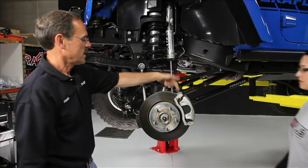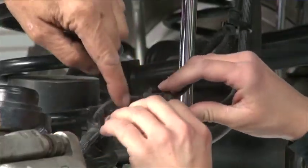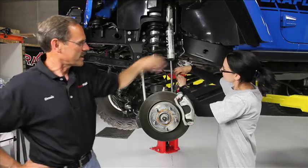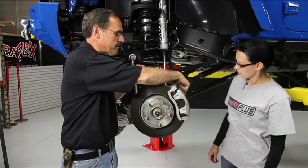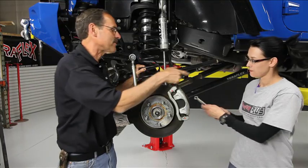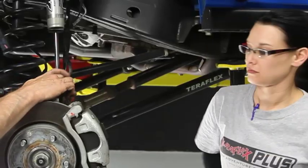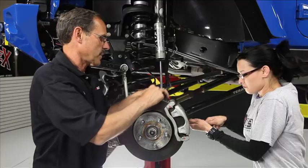I'm going to walk you step by step through the installation of this kit, so it'll be pretty simple. We're going to start by undoing these — start by undoing all the lines on there that attach the ABS line to the brake lines. Then we'll be able to move the caliper up here and get it out of our way so we can get access to the rotor. Let's grab that 15mm end wrench and we'll break loose that brake line.